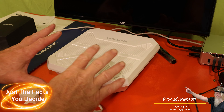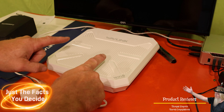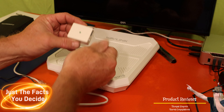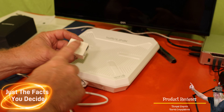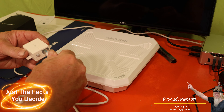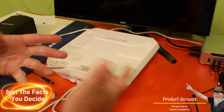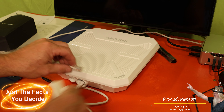I want to show you how easy this system is. I went ahead and reset it — there's a reset button right under the little rubber tab that allows you to reset it and go back to factory. I've got the ethernet cable plugged in and this is the PoE switch that comes with the device. I've also used my existing PoE switch and it worked fine. The PoE side is what you need to power this device, and the ethernet cable goes to whatever device you're configuring it with. You can configure it wirelessly or wired — I'm plugging it straight to a mini computer.